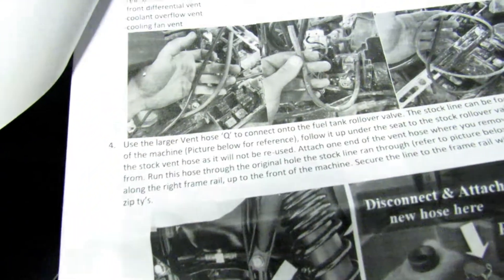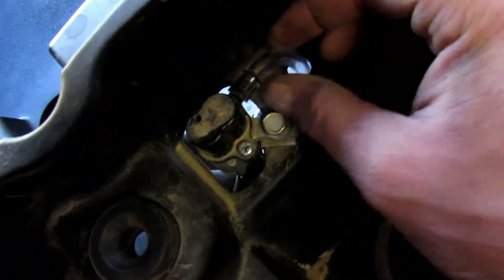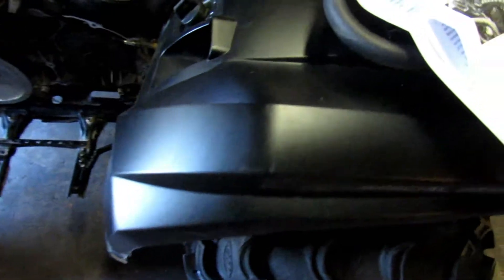I think we've got one vent there and then some underneath. The directions are very clear — I really like how it was all laid out. First thing I done was replace the gas line vent; the stock one comes off, you put the new one down, run it underneath and then it pops back up. You can trace your rear differential right there — we're going to have to splice into it to run it up higher. And now we've got a few more vent lines to do, and I'm just going by the directions.